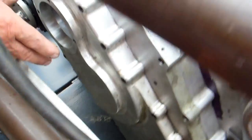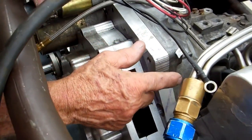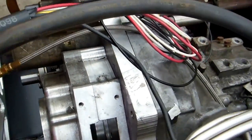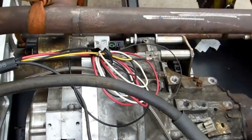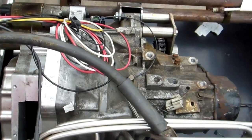It's got a chain out of a four-wheel drive that goes from here to the crankshaft. Then there's a pair of quick change gears that go from there to the transmission. The flywheel, clutch, and starter all operate off of the stock Escort stuff. It's a five-speed out of a 2004 Escort.